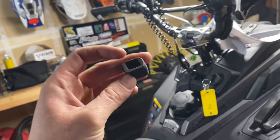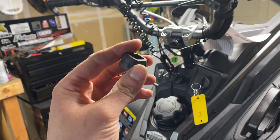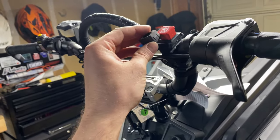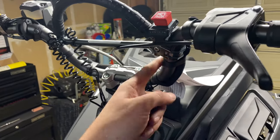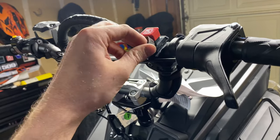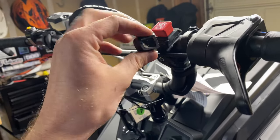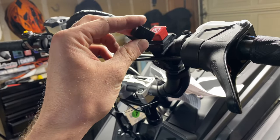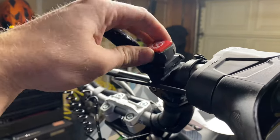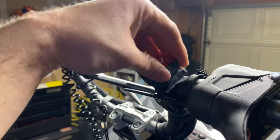This little kill switch rubber — it's my third year with it. You can buy them from Zollinger Racing Products, ZRP. They go right here on the kill switch. I'm a big fan of the stock location; I don't like putting it down lower because I run handlebar bags. This prevents it from getting knocked down while riding — you actually have to press and hold it down to turn it off. Now it's installed and you can't just click it accidentally.